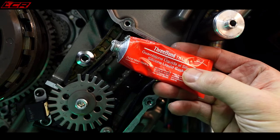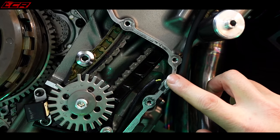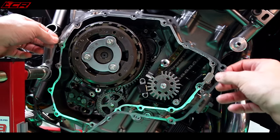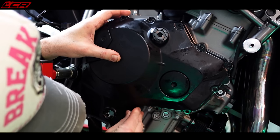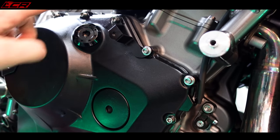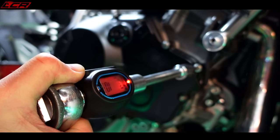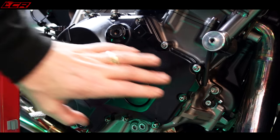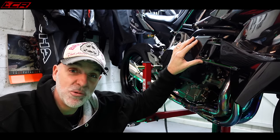I've got some special gasket sealant — my Ducati three bond liquid gasket. Ducati gasket sealant in a Kawasaki! A little smear of that across that surface there, then the new gasket. What's really difficult with this is there are no dowels or anything to align it. Mavis, what's the torque settings for the clutch cover bolts? Clutch cover bolts at 12 Newton metres. So it wasn't crisscross all of them — just crisscross for the first two and then all the way around. That's the casing all back on, all torqued up, and the panel back on the bike as well.